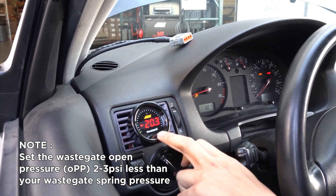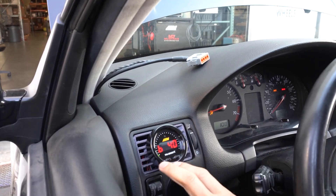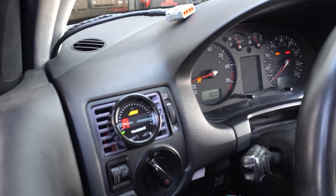We'll go ahead and set our A duty cycle. Now that we know our wastegate pressure is 4.75 pounds, we'll start with something safe around 20%, and we can set our B duty cycle a bit higher — 40% should be pretty good. Now we want to make sure we are actually enabling boost control by holding the left button down, and it'll display A, letting us know we're on our A setting at about 20% duty cycle. Now I'd like to talk a little about boost control duty cycle — the percentage value doesn't necessarily correlate to any specific boost value increase. A low value equals low boost, a higher value equals more boost, so you want to start small and work your way up a little bit at a time — you don't want to send your pistons and rods into orbit.